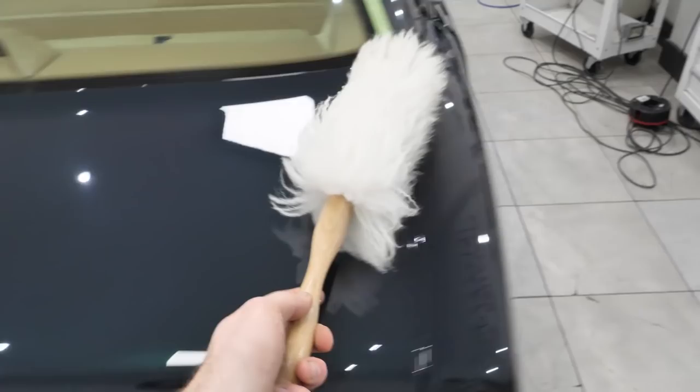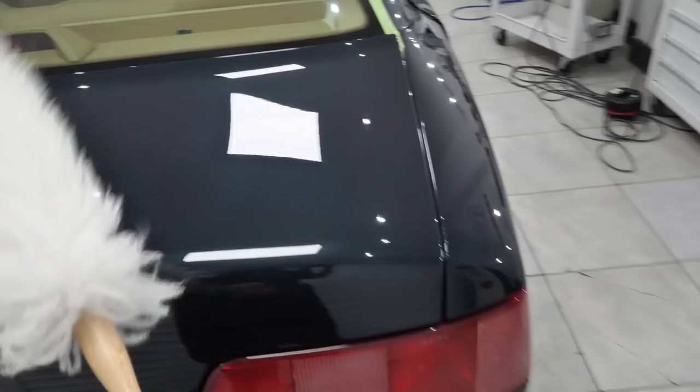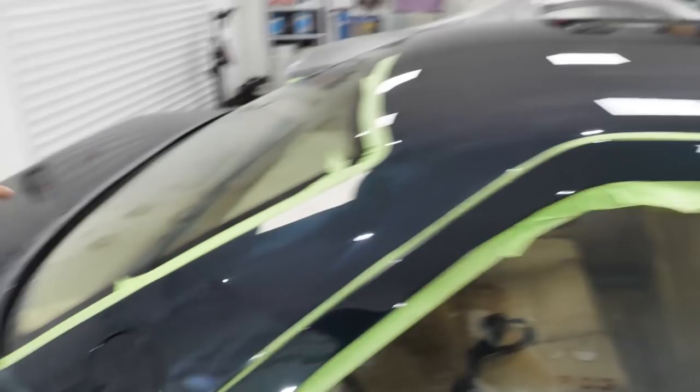But the clue's in the name. It's a duster. It's full of dust, typically. It's what we use during the cutting to eliminate fragments of polish and clumps of whatever else. So this, in the refining stage, can be lethal. That stays to one side to wipe down the panels that haven't yet been refined. So, with this, we need to blow. We need to blow this off without any contact to eliminate the dust, and certainly what we don't want to do is start buffing on top of this. This is going to trap all the contamination between the cloth and, similar to the boot lid, you're going to mark it, you're going to mar it.